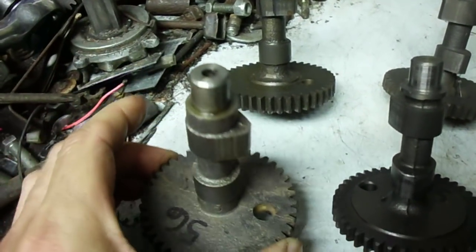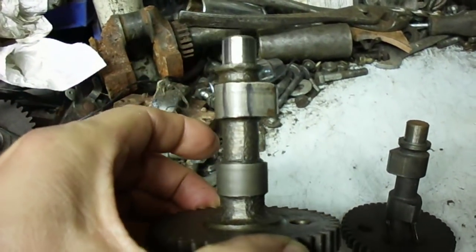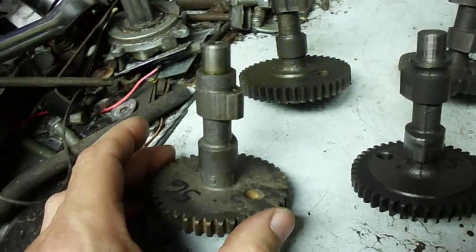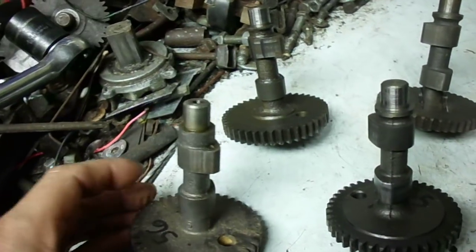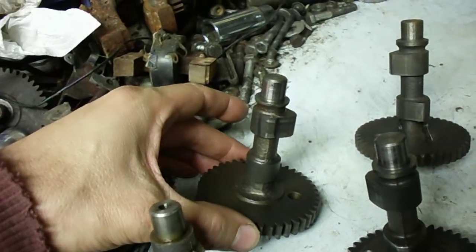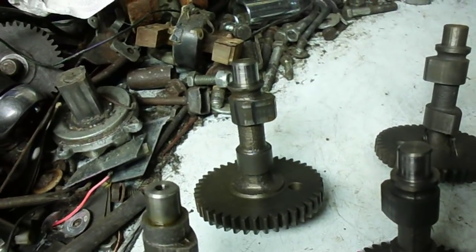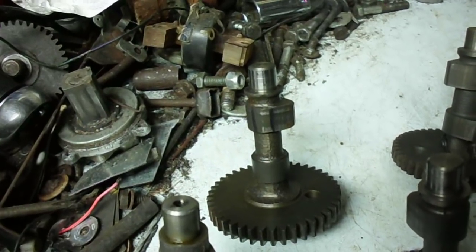This is the 1956 one without it, and then in 1963 they developed the easy spin starting compression release. These old camshafts are made of cast iron or some iron-based material — steel basically. They stayed in this configuration from about 1963 up until the early 1980s.